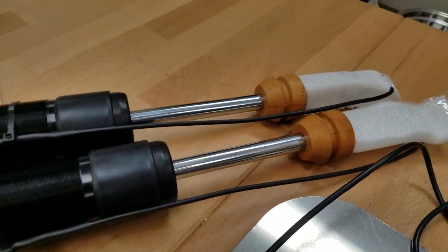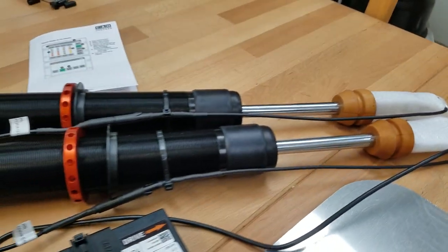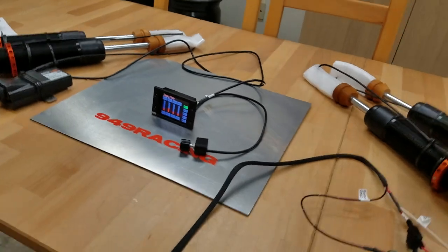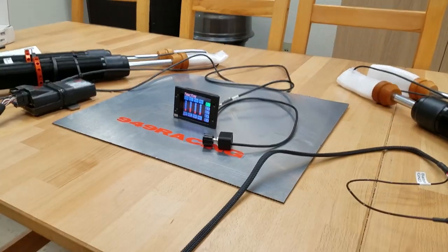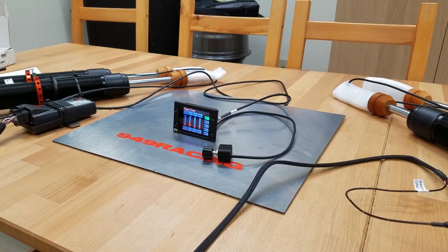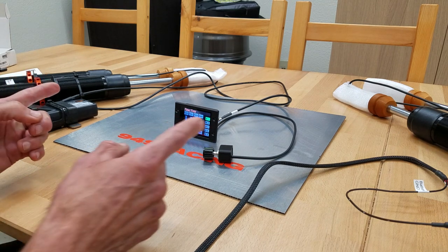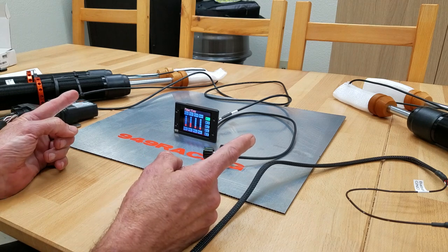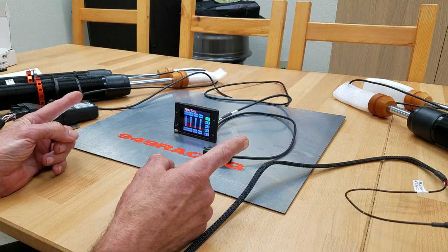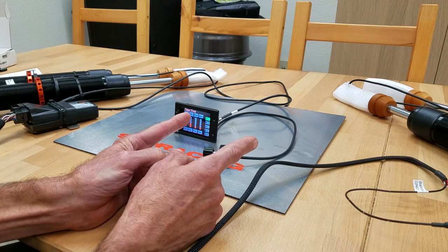This is the Ace shock — it's basically a regular-looking Zeta shock, but it's got a wire going out the top and all the control is done there. It's a very high-speed shock valve that can go from full stiff to full soft in about 6 milliseconds. What's unique is that while a given shock body has a total capable range of damping from soft to stiff, with conventional shocks you have to choose whether they're valved soft, sport, or full race.